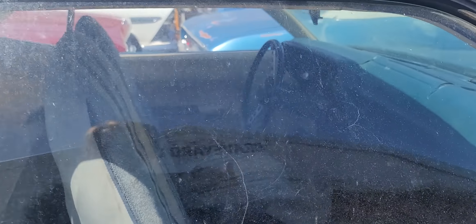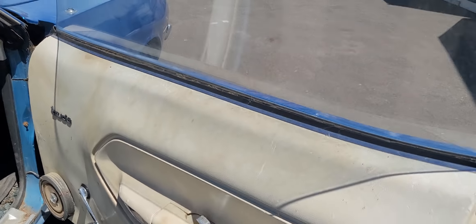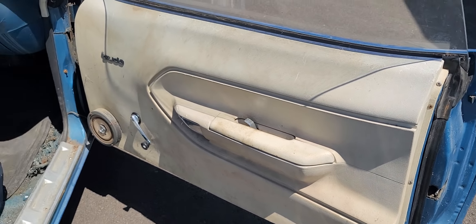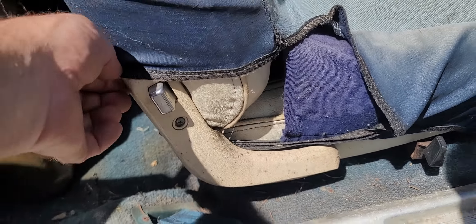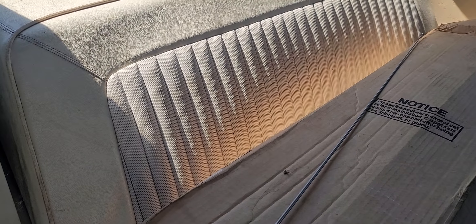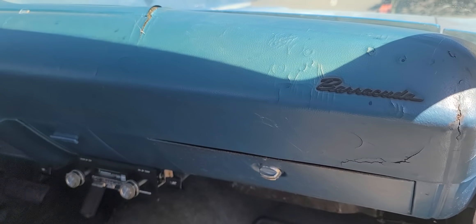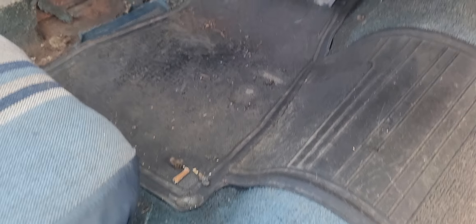We have the original date-coded glass. Let's take a look inside. Somebody's put a white interior out of a '72 Cuda in there, and how I can tell is on these seats — see this hinge cover right here? This hinge cover and the seat back are all one piece. The '70 and early or mid-year '71s are a two-piece, so that's the difference there. You can just tell on the pattern of the seats — that's also '72 style, could be '73 even.